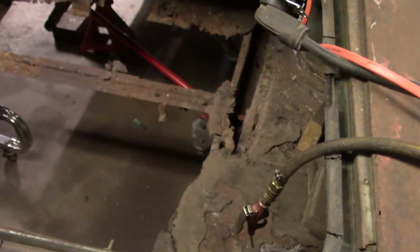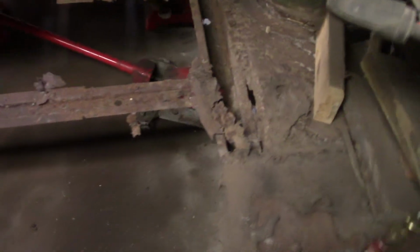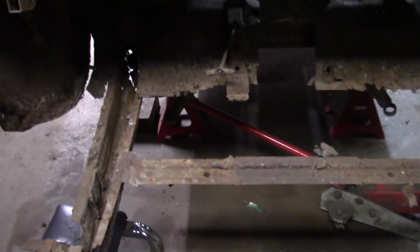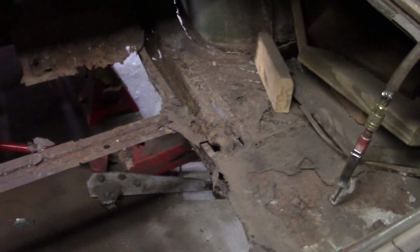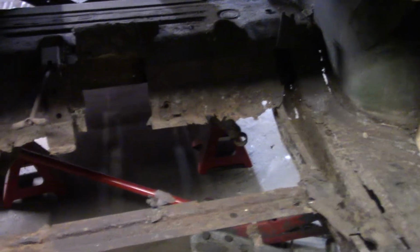And the rear frame, I got a really good idea off Rust Bucket Restos. That guy, man, and his 68. I think your 68 is worse than this, but not by much, dude. I've got half frame rails, so they go from the upper hump back there forward. And I think I'll do it like he did. I will put the frame rails together with the cross member and the taillight pan, or inner panel. And then I'm going to jack it up into the car as a unit.